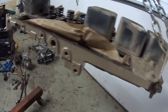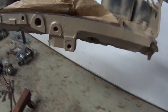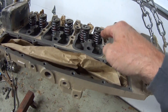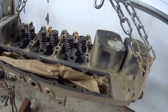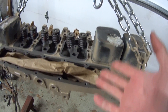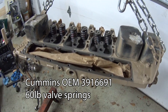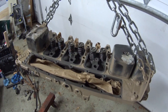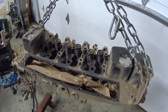I put some valve covers on just to protect the valves and keep paint off them. The valves are marked with white marks — those are the upgraded springs, I think they're 60 pounds. I want to rev this engine up to about 4,000 RPM. I already put the governor spring kit in the pump the other day, so those two pieces have been handled.